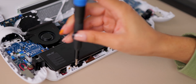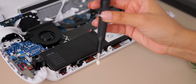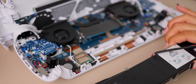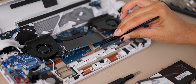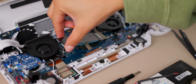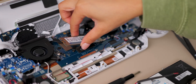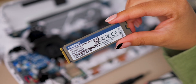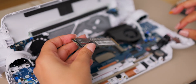ROG's guide does not call for removing the battery, but I had trouble pulling out the M.2 drive, so I went ahead and removed those extra screws and removed the battery. I suggest that while you're already looking to increase the storage on your drive, also look for a faster drive because the one that comes pre-installed is not as fast. Since it's an NVMe drive, you can increase the storage and also increase the speed.